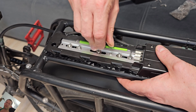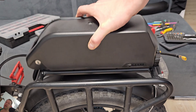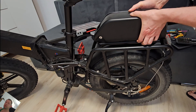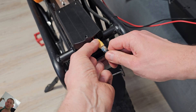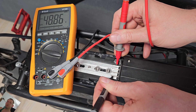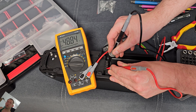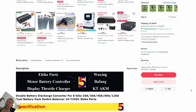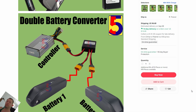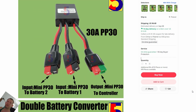Check that the adapter fits perfectly. Tighten the screws — but not too much, because you can damage the battery adapter or the printed part, and not too little, because the battery can move around. Install the battery to check if everything fits together, but don't connect the extra battery to the system yet. First, connect power to the adapter, measure the voltage, then check the voltage on the extra battery. In my case they were almost exactly the same, and then I knew it was safe to connect the extra battery. If you want to avoid this problem, there is a special adapter that allows you to connect batteries with different voltages — one can be fully depleted and one fully charged and it won't go boom. You can find the link in the description.